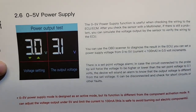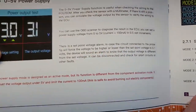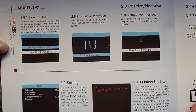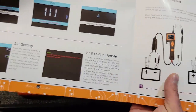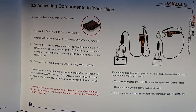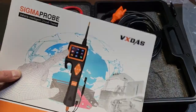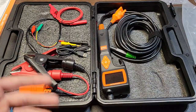There's a 0-to-5-volt power supply section, which is great when you want to diagnose anything with the ECU or items that are 5 volts or less. Then you have injector testing, positive and negative interface guidance, and it does have online updates as well. Continuity tests, oscilloscope, activating components, and the warranty — one year — plus the service process. It's a pretty handy user manual, especially since this is not as simple as a base circuit tester.